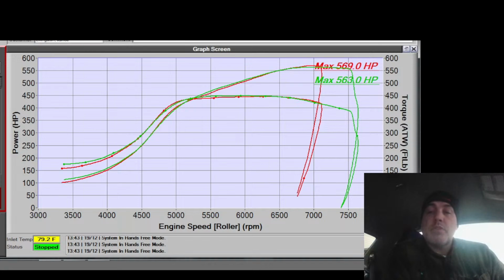Oh yeah, with two 1050s and two 450s for pumps, with some GTR controllers on there, you will be in a position that you can run, you could probably run 800 wheel on that, technically. So on that setup, you do about 800 wheel on it. But the beauty is you'll have 1050s. So it'll idle like a champ. It'll drive with pump gas like a champ. It'll just be wonderful.